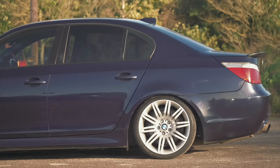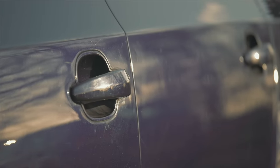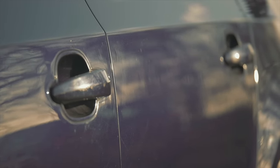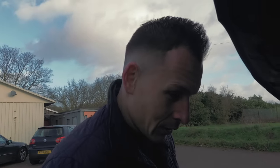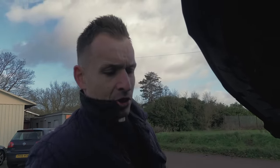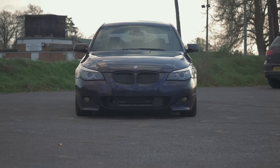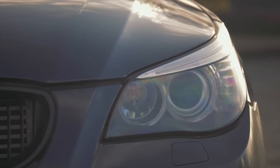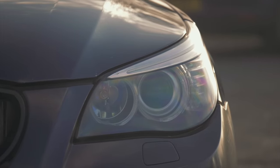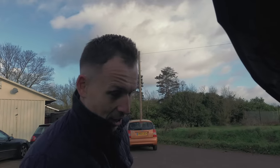And what are you running today? So at the minute, that's 604 brake at 610 lb-ft. So yeah, she's frisky. That's crazy. And what's the engine good for? The engine's good for about 1,000 brake. It just needs a set of cams in there, different coils, different injectors, and it would be good. What's the plan? Are you looking to up the boost soon or change the turbo? I'm wanting to be about 800 brake, but as it sits now, that's frisky as it is. More than enough, yeah.